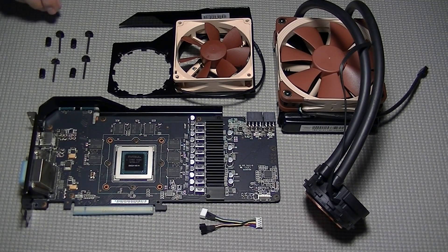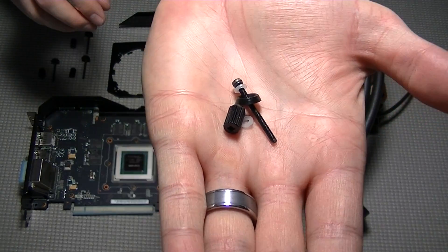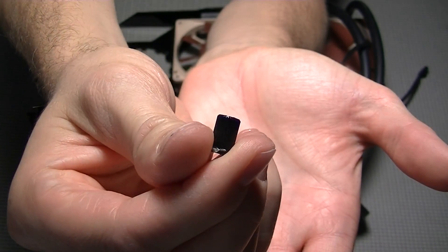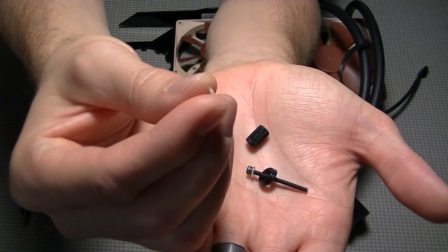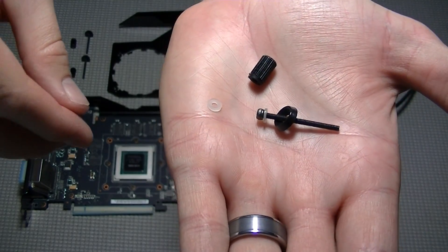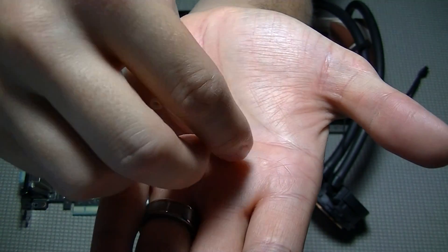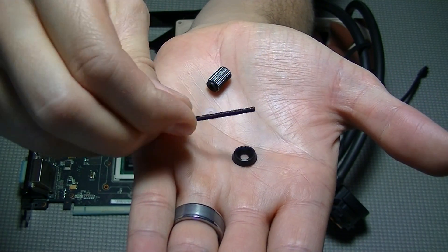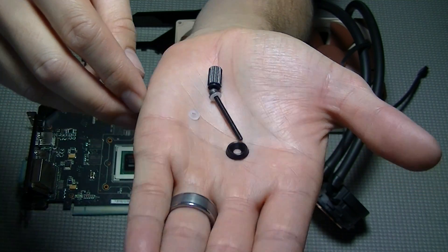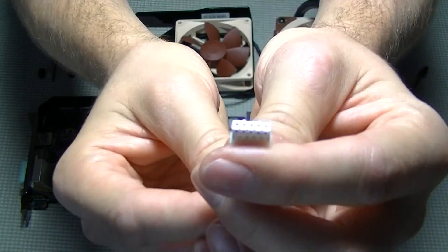Next, it's time to prepare the card, bracket, and the AIO-style cooler you've selected. I chose the Corsair H75 and upgraded the fans to Noctua NF-F12 fans. Since I'm doing a custom mounting with the GPU bracket, I decided to keep the ASUS DirectCU backplate, which requires some special hardware — all linked in the description. You'll need a total of 8 white nylon washers, 4 finishing washers, and 4 M2.5 25mm screws. The thumb screw shown is the one that comes with the Kraken G10 kit. I prefer the Noctua NF-B9 for the bracket itself and the NF-F12 for the cooler.